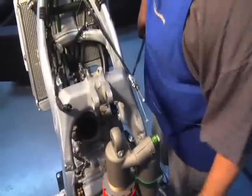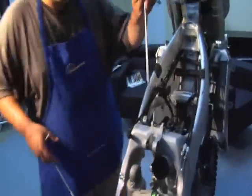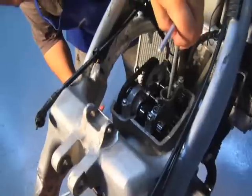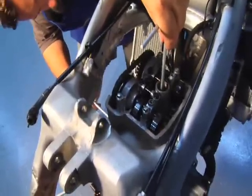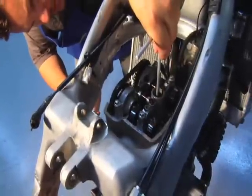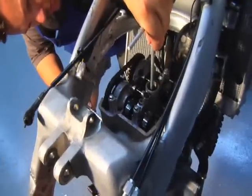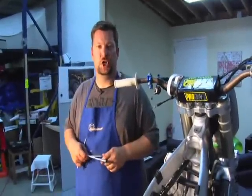Of course, the spark plug is out right now. And then we found top dead center, as you know. But I'm always one to check before I go in, so I'll just get a T-handle or a screwdriver, something. Drop it down in there, and I'll find top dead center with it. And I'll double check my marks, which we're good. Top dead center has been found. Everything is tight. Now to finish the job.